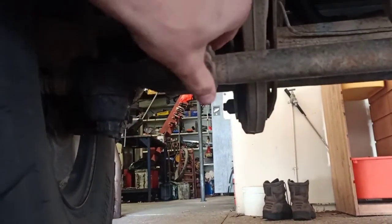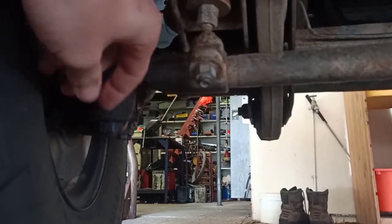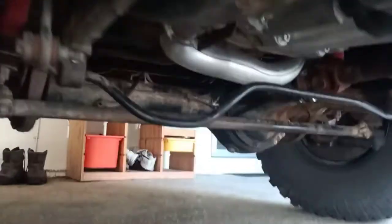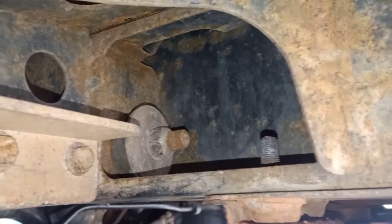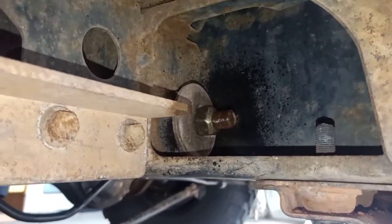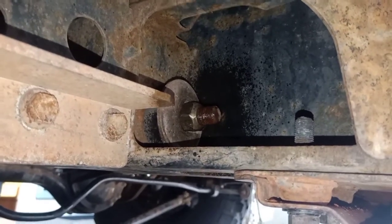To do it on a Nissan Patrol, to get the radius arms out you've got to take out this drag link for the steering. I've just undone that nut — I need to undo it more, then I'll pop it off with a ball joint separator. Take that out, take the sway bars off the arms, and then undo that nut there and it all comes out. It's pretty self-explanatory. This thread gets all rusty and a bit difficult, so I recommend spraying some penetrant on it and leaving it before you start. I've just used Ballistol — probably not the right stuff but better than nothing.